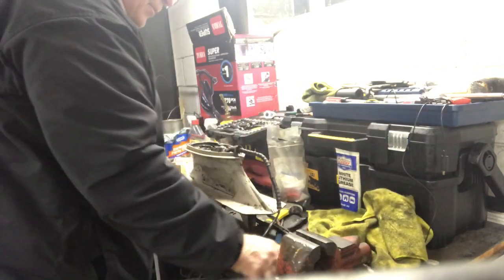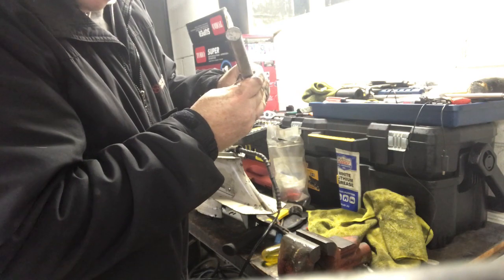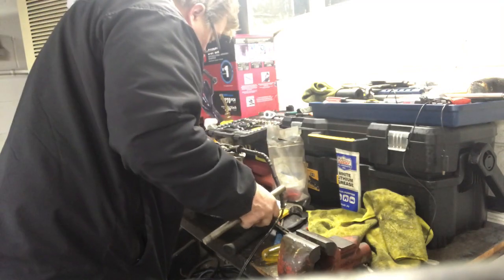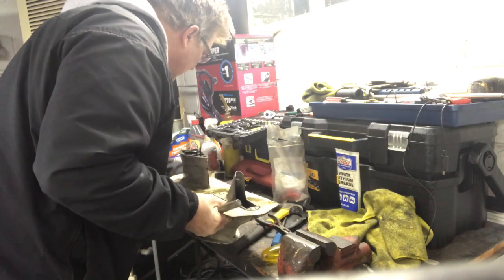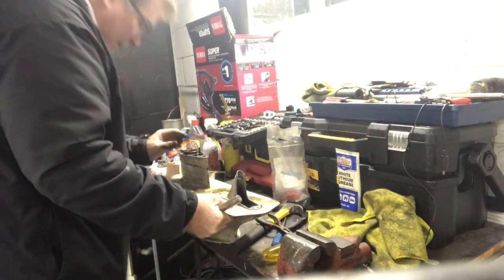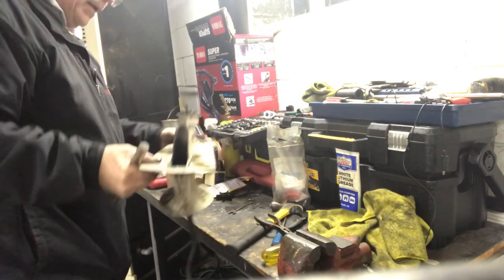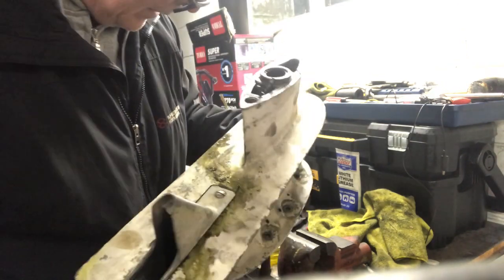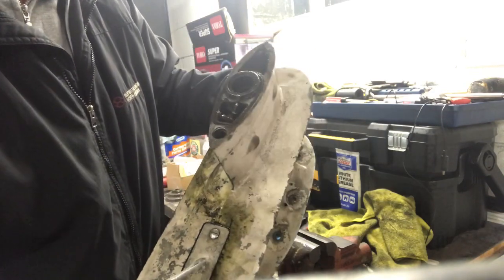This is what I purchased, and I'm sure that'll work. There's actually a part number on here etched into it: 309916. If you punch that into marineengine.com, that tool will probably come up. I found it on eBay for about $18 — seems worth it. Let's see if it does the job. Oh wow — this bearing's froze up too. That's the pinion bearing on the bottom of the shaft, all froze up too. I don't think I have another one of those. Those needle bearings are all locked up. I'm going to squirt them down — maybe I can get them freed, but that's not good. I'll have to search the web for that bearing as well.